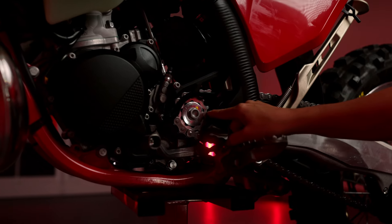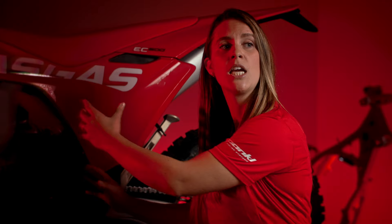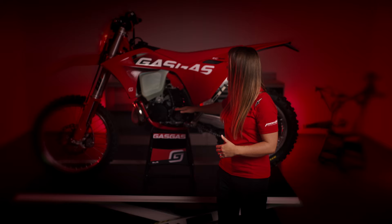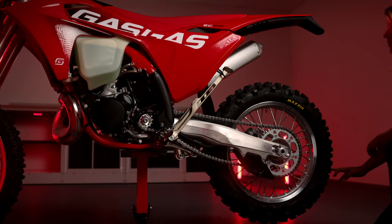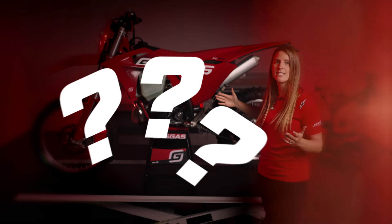So, to achieve the desired effect, we tilted the engine backwards, resulting in the front sprocket moving down a bit. This shift in the engine's orientation results in a lower front sprocket, combined with a consistent position of the swingarm, which led to an increased chain pull to the front and a higher rear end.